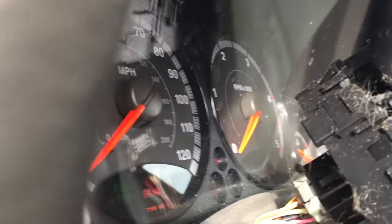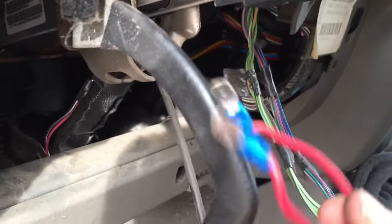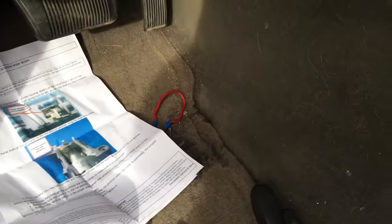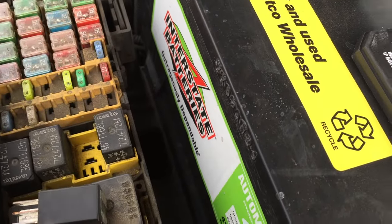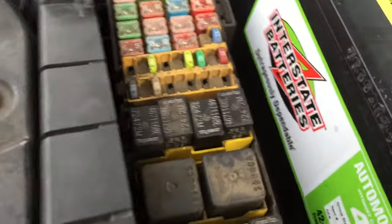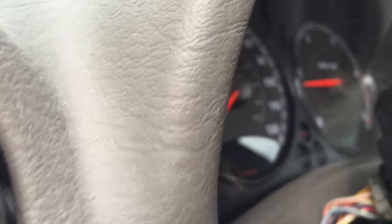Can't crank it up yet — I've got power to the ignition switch but when I turn to crank, I'm not firing. I need to go put in my starter relay. This is how I've been starting it with this bad switch: put the key to on, pop the hood, and go put in the starter relay. I had already tried swapping the relays around so I knew it wasn't a relay issue. I go jump the starter relay to crank it over after turning the key on. Starter relay back in — now turn my key on. Hey, look at that — starts right up!